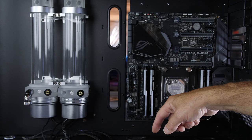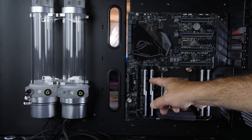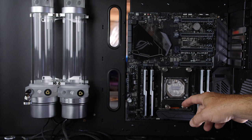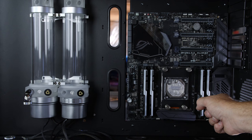I can't come up here because tubing is going to come across from the graphics card for that. And I don't want to cross over the memory in case I need to remove it. So I want to go back down, either down and over or down and straight through. So I need to reorient this. I'm going to have to take it off, clean off the thermal paste, and see if I can turn this block that way without any issue. All right, so that's the plan.